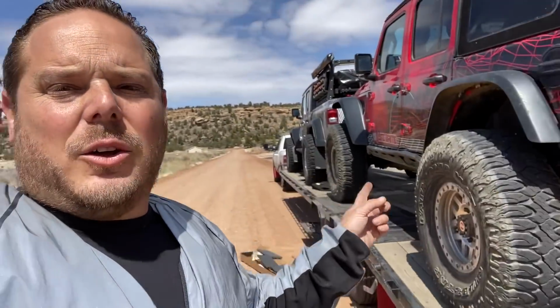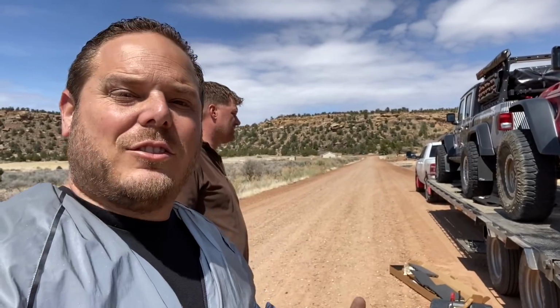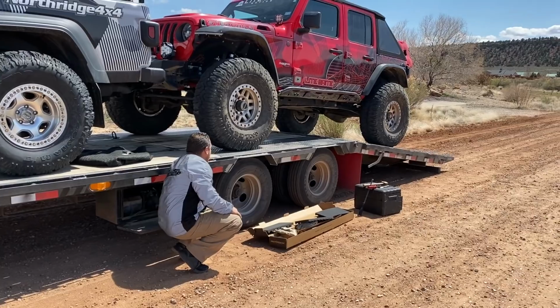Okay, so that's it for the drive shaft. It's actually super simple. What we did was leave the transfer case in neutral, and then we put a wrench on the bolts, and he used a crowbar or a pry bar to spin the drive shaft to tighten those nuts and bolts down. So now we're gonna unload the Jeep, pull it in the driveway, jack it up, get the wheels off, and get to work on this AntiRock sway bar.